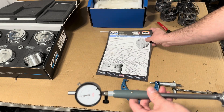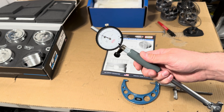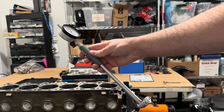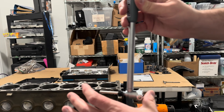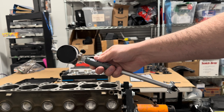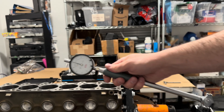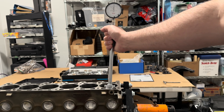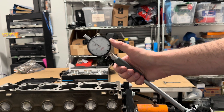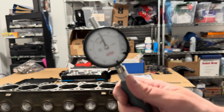There are tons of really good videos that explain this better for machinists, but that's how we set this up. I'm going to turn the camera over to the engine and show you how we measure this. I went out, put my outside micrometer in a vice, set this in and got it zeroed out. Keep in mind the temperature of everything will change a little bit — a few tenths with this kind of stuff — so you may have to measure it twice. We're going to set this in the bores and go up and down in a few different spots, seeing how different the reading is from the standard, which I have set to 85 millimeters.